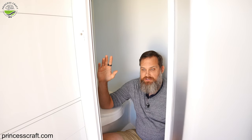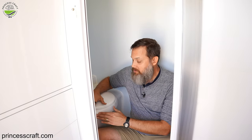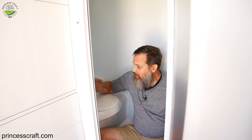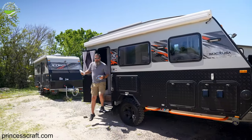Use the flush water but don't use too much or you'll have to empty the tank more often, then close that valve and you're good to go. Some people recommend keeping a little bit of water in the bowl when not in use to keep smells from coming up. However, Thetford recommends in the manual that you do not keep water in the bowl — it can waste water, and if you properly maintain your tank, valves, and use proper toilet chemical, you're not as likely to have a smell issue anyway. Also, do not travel with water in the bowl because bumps can cause it to slosh out onto the floor — nobody wants that.